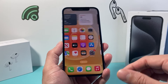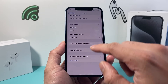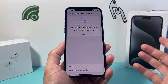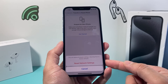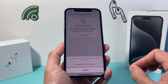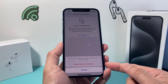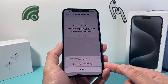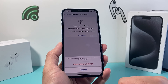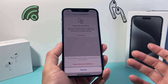Now if you did all of that and it's still not working, the next thing to do is go into your iPhone Settings, go to General, scroll all the way down, click on Transfer or Reset iPhone, then click on Reset, and do a Network Reset. What a Network Reset does is reset network-related settings only — it will not delete any of your personal data. All of your photos, videos, and apps will be safe on your phone. It will reset things like saved Wi-Fi passwords, any Bluetooth-connected devices, and any network configuration. This is something you need to do if you're still getting no service, invalid SIM card, or SIM card failures.